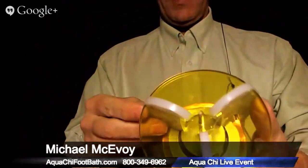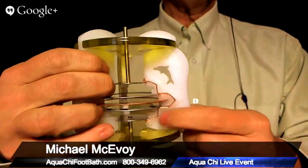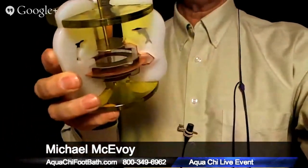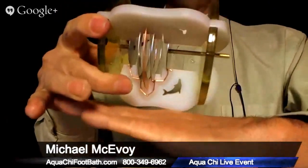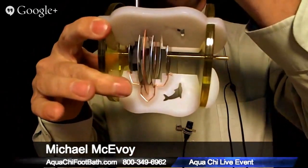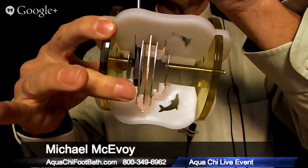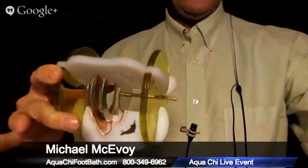Okay. Once you've got it back in, what I like to do is just check, go back to this, and make sure that this silver ring on either side of the copper ring is fully seated in, up against this copper strip here in the leg. The easiest way to do that, if you see that it's not fully seated, is to put this part of the module on a table, and then take a flathead screwdriver and come in pushing down. I don't know if you can see that well. Yeah, pushing down on the silver ring. It's going to take some pressure, pushing down to make sure that it's fully into the leg there. Same thing on this side, okay? You do both of those, and then you're good to go.